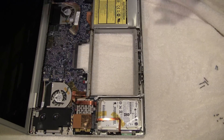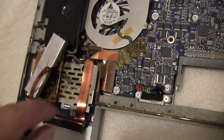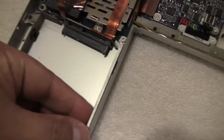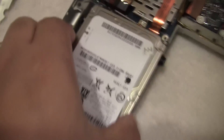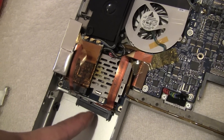I've already removed the hard drive. Basically, there's a hard drive cable right here and the hard drive sits in here with screws that match up. To remove the hard drive, you have to remove one piece of metal — a metal bar that sits right here. Unscrew it here and there at this hole, and the metal bar lifts out, allowing the hard drive to slip up and out like this.